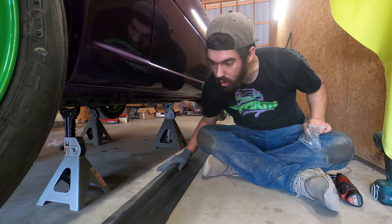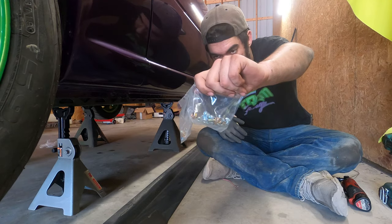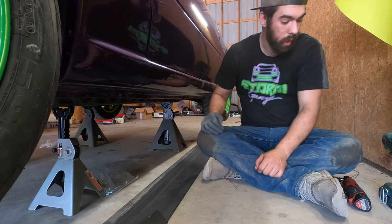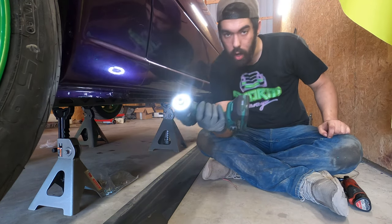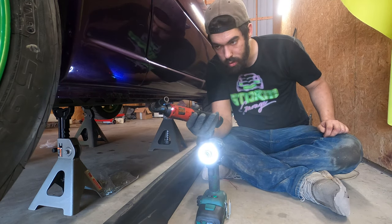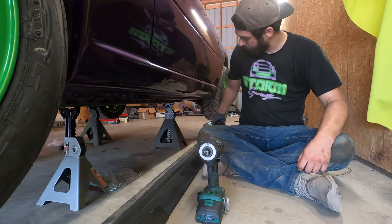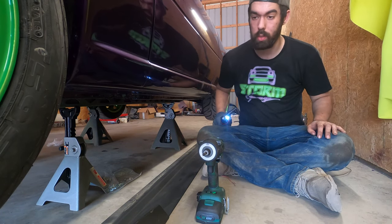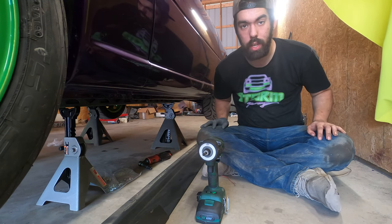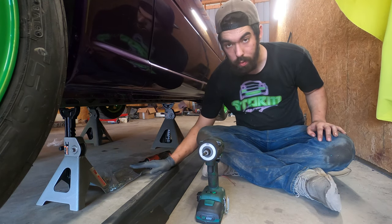This is a used garage star side skirt — it's in pretty good condition still. I got some hardware from a different side skirt that I'm going to be using to install this. We need a quarter-inch impact with a Phillips bit and a 10-millimeter socket to pull the two bolts up here out. I only have one because the other one snapped off in the car — I might pull it out another day, but today is not the day.